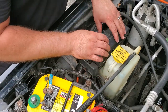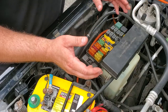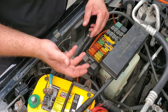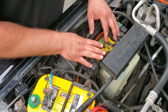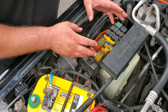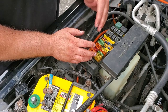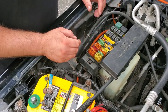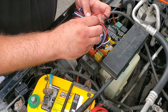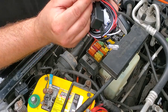All right, guys, the last thing I want to talk about is the wattage of these fog lights. Now, the box says they're rated at 240 watts per light. So this fog light system has two lights, so we're talking 480 watts. If you divide the watts by the 13.8 volts that the vehicle runs at, you're getting about 35 and a half amps. Now, that's a pretty strong current, and the amp rating for the fuse they give you is only 30.